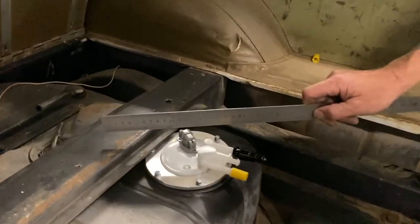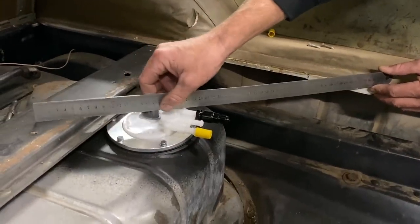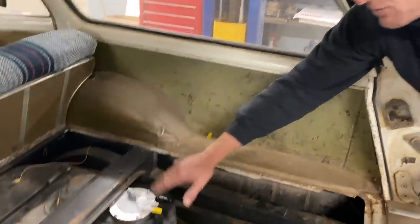What we're going to do is get Jay to whip the tank back out, we'll cut it, we'll lower it down 20mm. At the moment we're hitting by about 3mm, the fitting may have 5mm clearance, so theoretically that should give us 15mm of clearance — a lot safer. It's a high pressure pump, so if we snap a fitting we don't want to be filling the car up with fuel. Tank back out, we've had a miscue, we'll get it rectified and show you what it looks like.